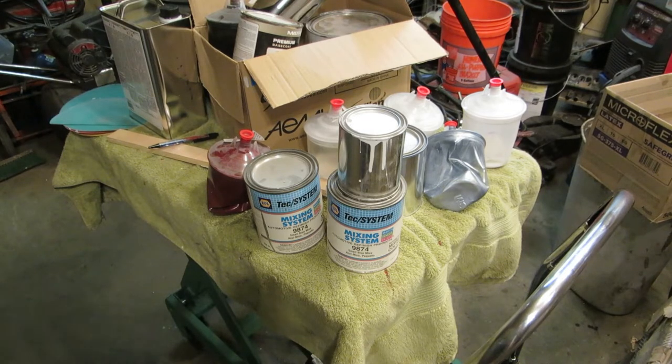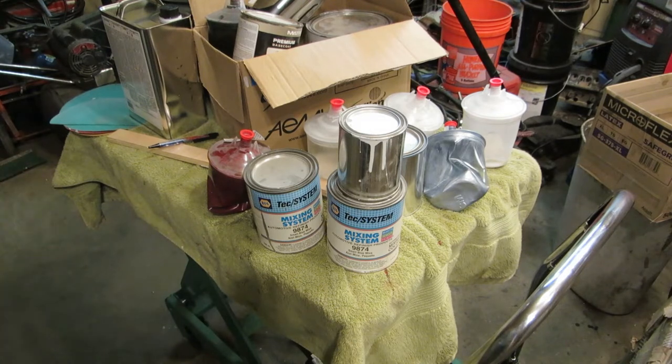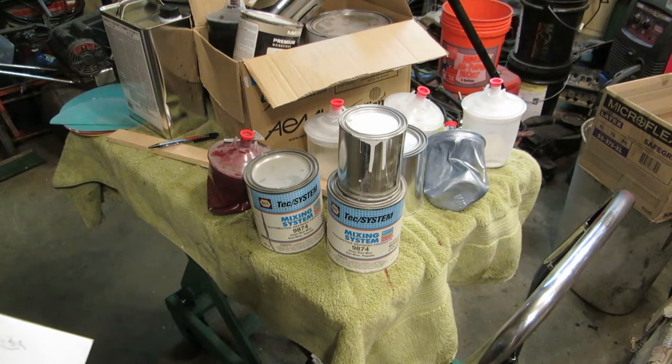Some other things about your plan. I'm going to set up the Quonset hut outside over the car. And what we'll do is equip it with the tools and compressor and air and electricity and all that stuff so that we can work on it. We're going to start on the car, and the first thing we're going to do is our sandblasting, and then we're going to do our metal work. And then we're going to coat the underneath side of the car, the bottom side of it. I'm going to use black Rust-Oleum because I have some. And then I'm going to paint the inside of the trunk and inside of the hood. That's the engine compartment and the trunk compartment.